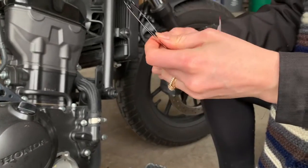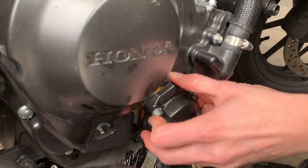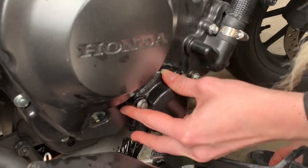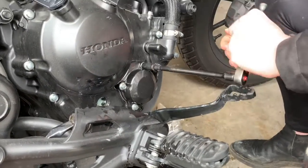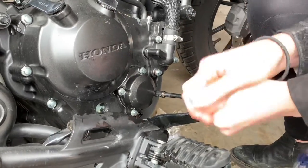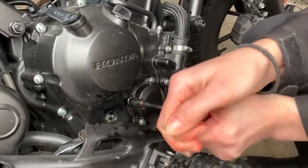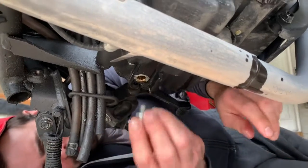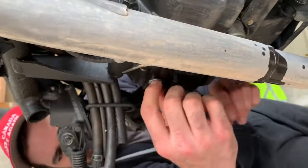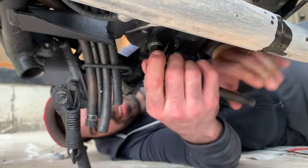After you gently pop the new filter in, you're going to put the cover and the new gasket back on. Be careful to keep the spring in place as you do this, so it's in the correct position after you've tightened the bolts back on. Hand tighten the bolts firmly so they're snug, but make sure they're not too tight. Over-tightening can do more damage than good. According to Honda's specifications, if you're using a torque wrench, it's going to be 9 foot-pounds for the filter bolts and 18 foot-pounds for the drain bolt. Always refer to your Honda manual just to make sure. That's it.